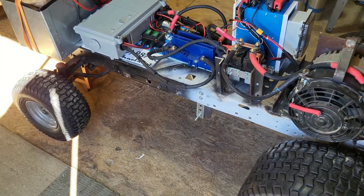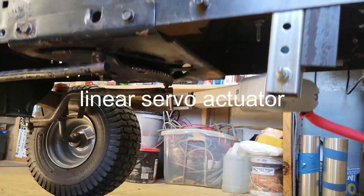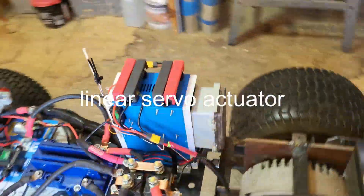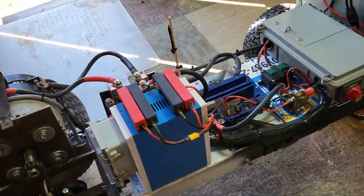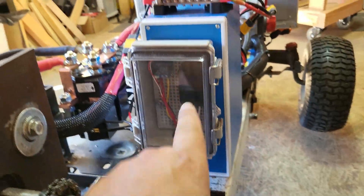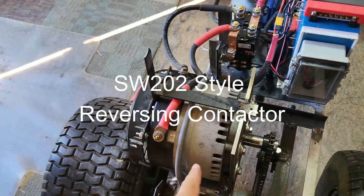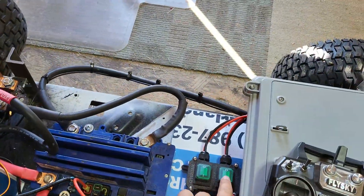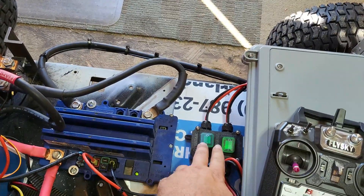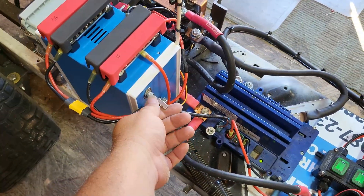The big difference on this one is it's gonna be remote control — steering actuator, servos running the throttle, just located in here. Different relays in here, master solenoid for forward and reverse right there, motor fan. Standing demonstration: main power on. Auxiliary 12-volt, auxiliary 24-volt. I've got a manual switch right now for my fan.